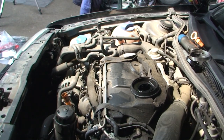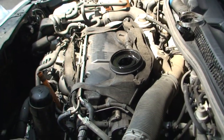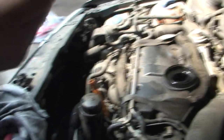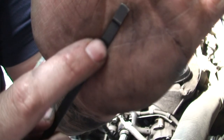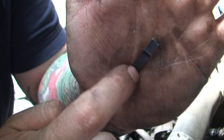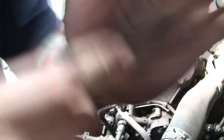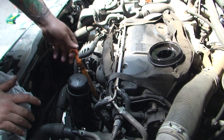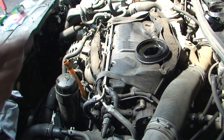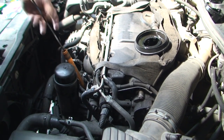I'm just going to give that about 30 seconds just to let it all make its way down, then double-check it with the dipstick. On this particular one the levels are straightforward — you've got that little hashed-out area with the minimum and maximum mark, so you go into the top of that little dotted hashed-out area. We've gone over the mark, but that's okay because we've still got to put oil into the filter, so that's not a problem.